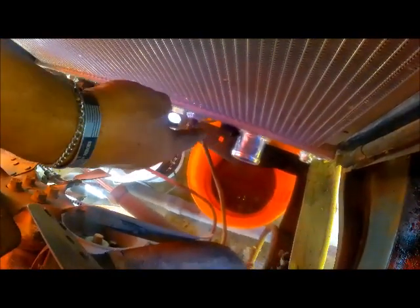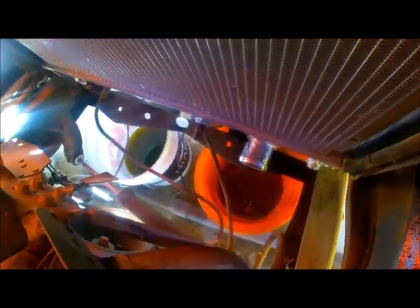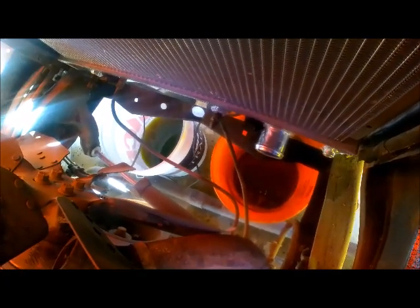Okay, that's in. The radiator is in. Alright, except for, of course, the transmission lines, because since they don't line up, I'm going to have to cut and trim, flange, and get those to fit, because the fittings are more to the left over here as to where the old one, they were all over here to the right. So I know it's not that bad of a thing, but of course I've never done it before, so now I got something else to learn.